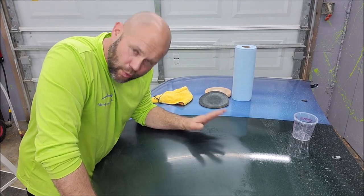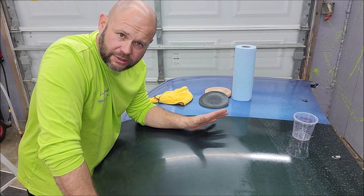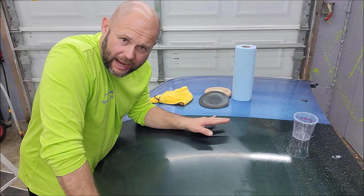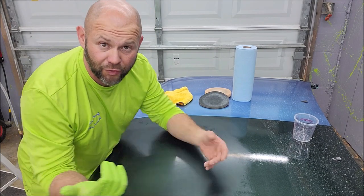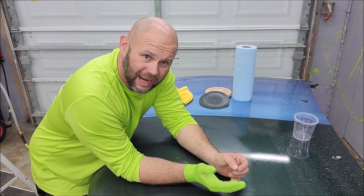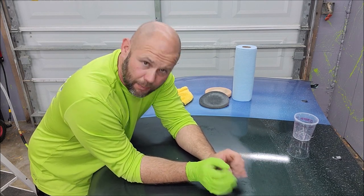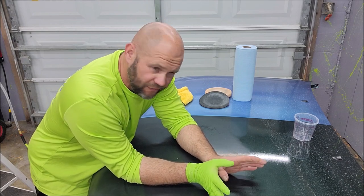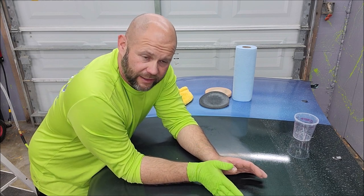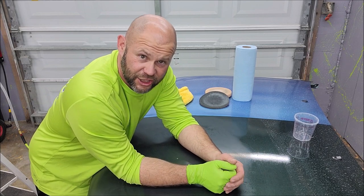It can be done. You can hand apply it, but by the time you do that and get it flat looking nice, I could have done about 10 cars. It's not worth it. Don't be scared of spraying. It's okay. And the other cool thing is we're not spraying colors. You're gonna spray pigmented clear or just straight up clear. If you don't wanna deal with the pigments, the pearls and the colors and all of that, the metallic, fine. This is amazing protection for auto, boat, RV, motorcycle. If it's got a steering device or it sits outside, this should be on it.